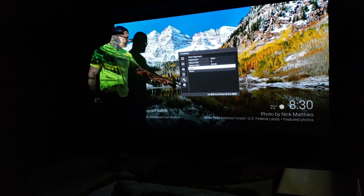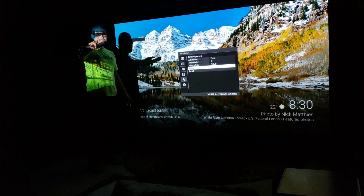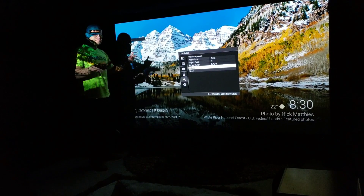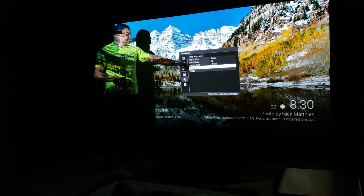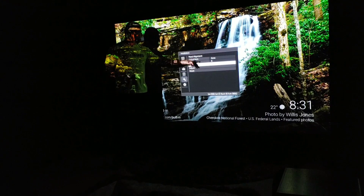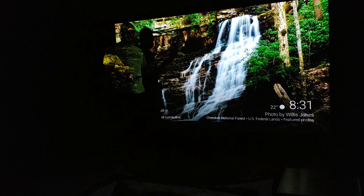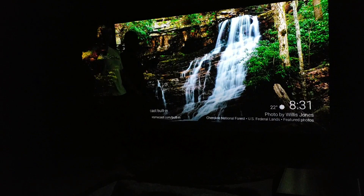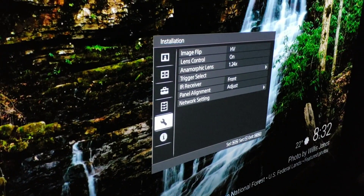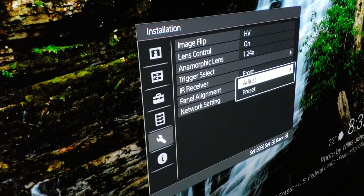Now that I've gone through the whole grid, all the images are crisp, white lettering is sharp with no bleeding, and the HDMI menu looks clean. I'm going to bring the camera in close to show you exactly what I'm doing to those grids. I'd recommend leaving the pattern/color setting on RGB and just adjusting the red or the blue panel. When looking at the white grid — if you see red, select red; if you see blue, select blue.